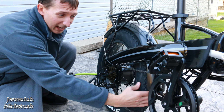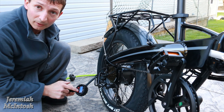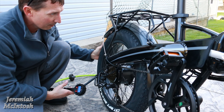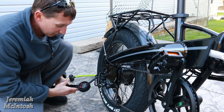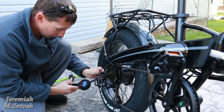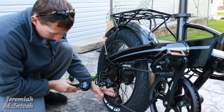One thing I noticed when you get it — these tires hardly have any air in them. They're only aired up to about five and a half pounds of pressure on my digital gauge. I'm gonna go ahead and put about 20 pounds each in them. The rating on here is 30 PSI, but I'm gonna keep it around 20 so it gives a little bit of cushion. I'll put a link in the description below for the gauge on Amazon and link a review video I did on it.